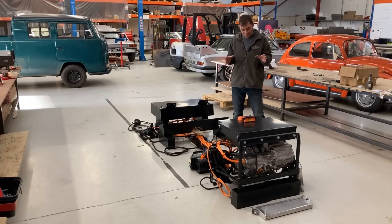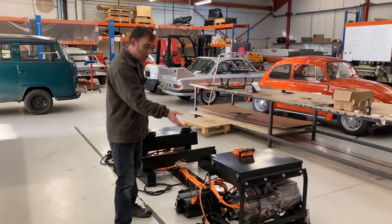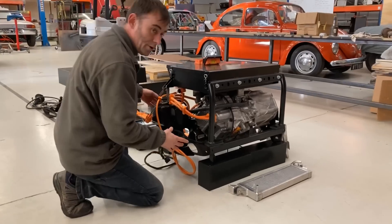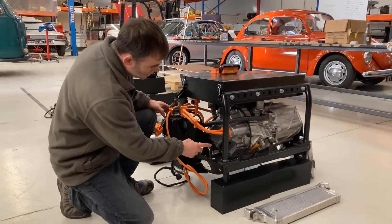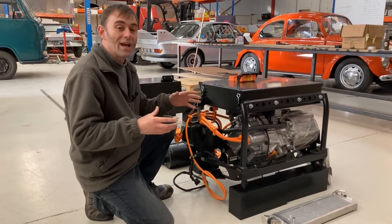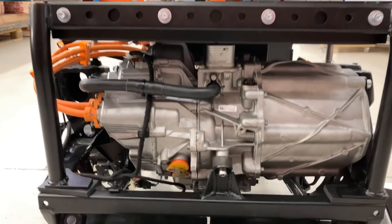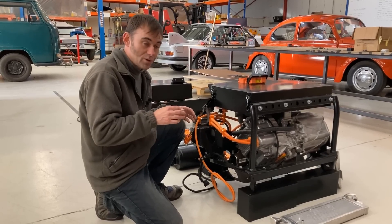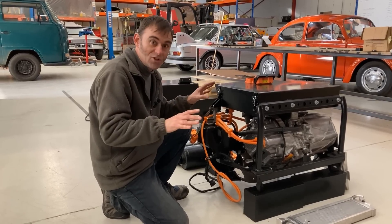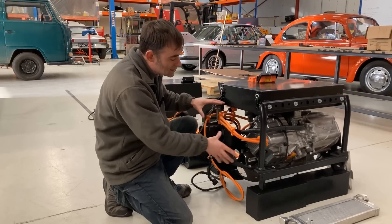So what have we got here? In essence, it's a bolt-in pre-wired high voltage and low voltage loom with a Tesla drive unit and a 31 kilowatt hour battery pack. Starting at the front — those that know their minis, this is a mini subframe, slightly modified to be able to cope with the Tesla drive unit. There's a small Tesla drive unit in there which gives a maximum of 300 horsepower. Now, 300 horsepower in a mini sounds nuts, but don't forget we can just dial that down. In road mode it's around about 100 horsepower, which is pretty quick but not stupidly quick. Flick it into track mode — please make sure it's on the track when you do — and it'll transform into an absolute monster of 300 horsepower instant electric power, basically a rocket ship. The small Tesla drive unit fits like a glove inside the mini subframe and just bolts in.